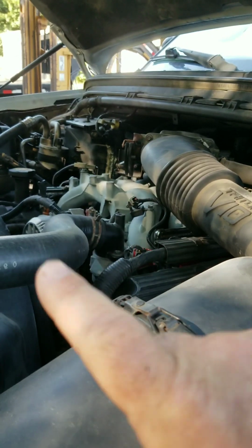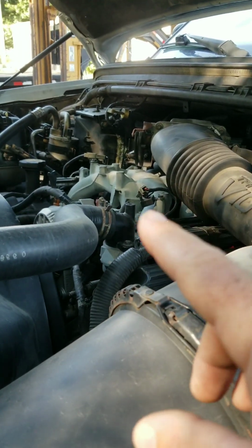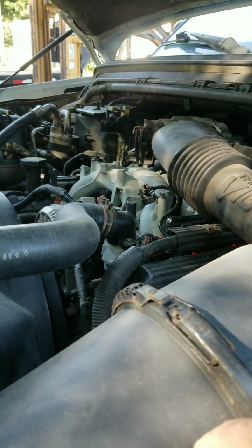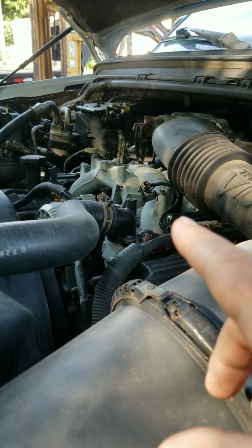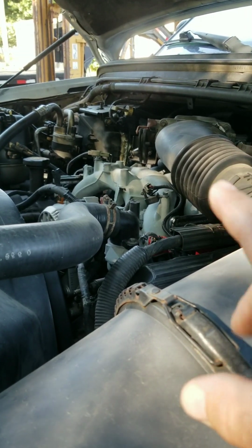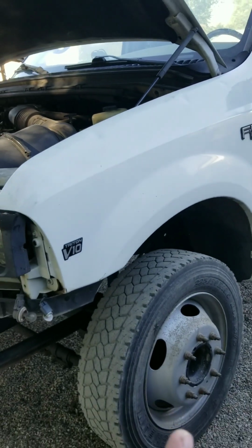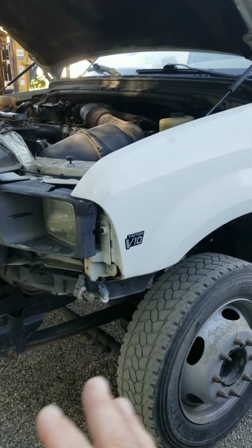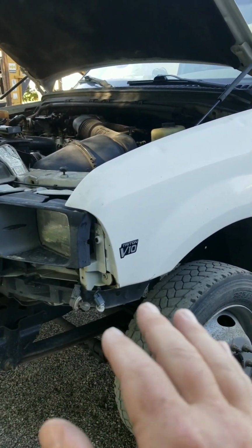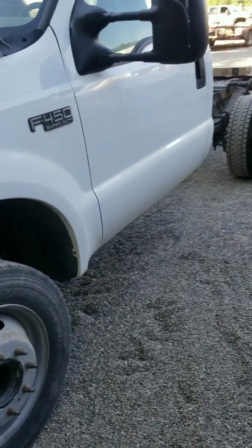The alternator, come to figure out, is drawing power the higher it revs up, and it's taking power away. Not enough spark, whatever is going on, losing power. So I put a new alternator on it. That problem's fixed in one way, except now when we step on it, it just falls on its face. Similar, but not exactly the same.